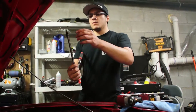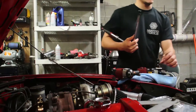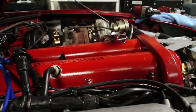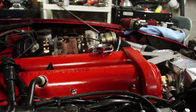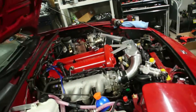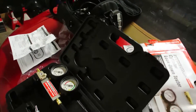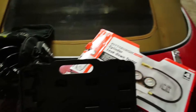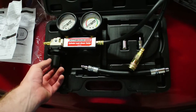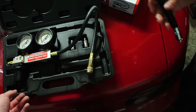What we're doing right now is removing the valve cover so we can do a cylinder leak down test, which will verify if the cylinders can actually hold compression. And if they can't, well, we might have a problem. You can pick up these cylinder leak down testers for $44 at Harbor Freight. It's a pretty simple test to do.